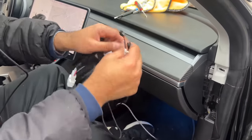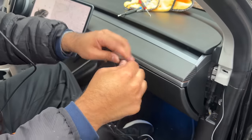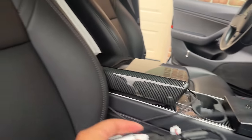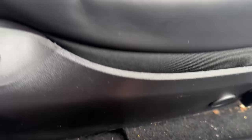Once you reach the bottom, grab the new OBD harness that came with the kit and connect the two black adapters together. We are then going to route this OBD adapter harness through the footwell, through the side central console area, all the way to the back OBD port behind the central console. You can also route this cable through the bottom door sill panel and pass it through the opening in the carpet.